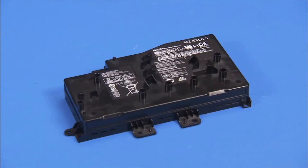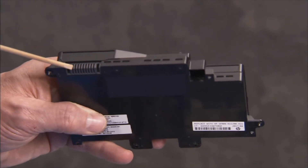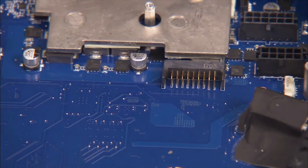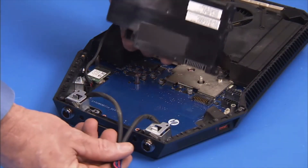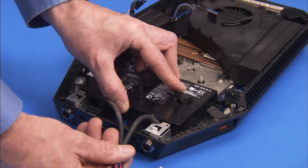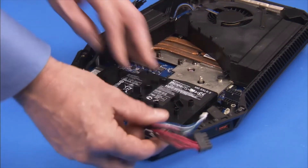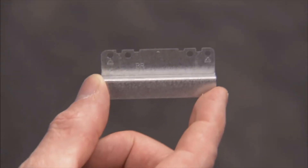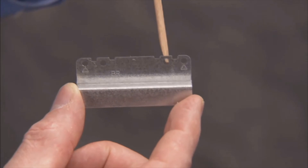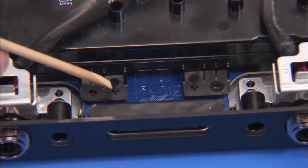The battery has several slots on the bottom rear edge that slide over pins on its motherboard header. To replace the internal battery, align the battery over the motherboard and press the slots straight down over the pins. There are two small holes on the small metal front bracket for the battery that fit over alignment pins on the battery.